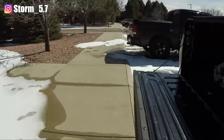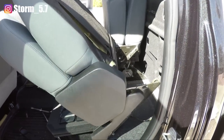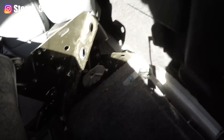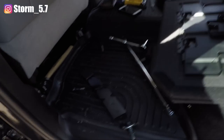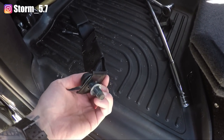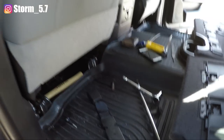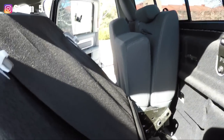Alright guys, got the seat unbolted. Make sure you keep the back left side — over here is gonna be the seat belt anchor for this seat — so just make sure that you keep this little assembly intact when you put it back in place. There's a washer on there, make sure you stick that up in between the seat the right way. Once you get the four bolts out, the seat'll slide right up past these two hooks here.